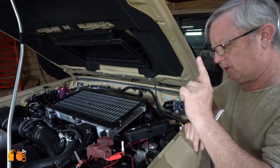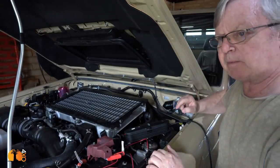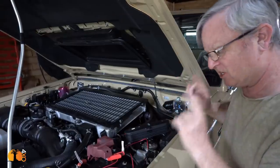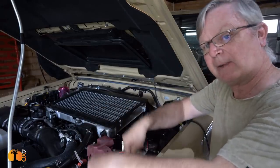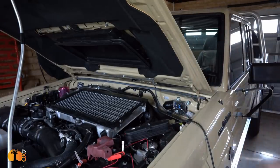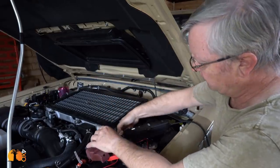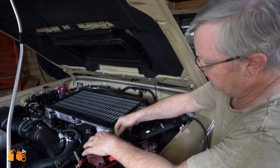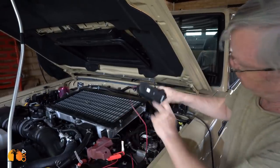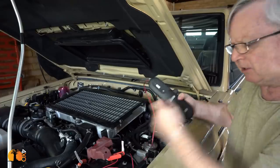I'm going to prove it to you right now. The battery in the back is probably at about 50% charge, and it's all connected except right now it's not connected to this battery — I disconnected it on purpose. I'm going to show you what happens. If I now connect it, I've got a 70 amp fuse that goes into my DC hub connector there. This battery is now full — showing float, it's full — and it's not very warm. I can see it's not pumping much current because the battery is full.